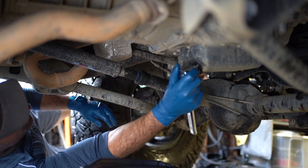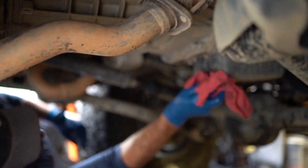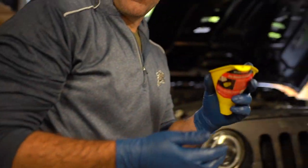And so, by the way, when you put that drain plug back, it's also really soft. It's 20 foot pounds. So you've got that torqued. If you tighten the oil filter housing also on the top, then you should be ready to start filling up the oil. Let's go ahead and put this funnel up.